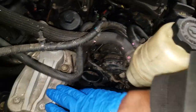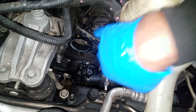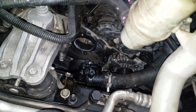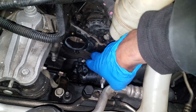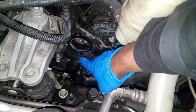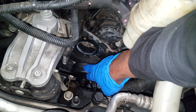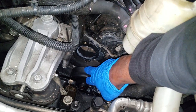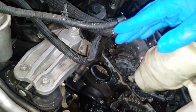I've got to get this motor mount up and out of the way, and then it should be visible right here. Without wasting any time, I'm replacing it because it's leaking under pressure while the car is running. A lot of coolant is just spilling right here, and right underneath it is the water pump — so it would appear the water pump is leaking when, in fact, it was coming from here.